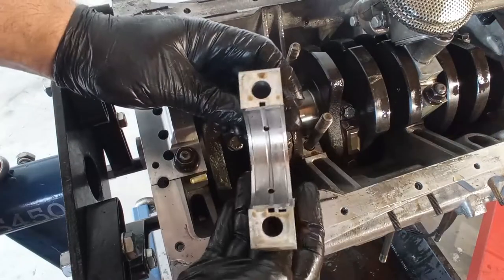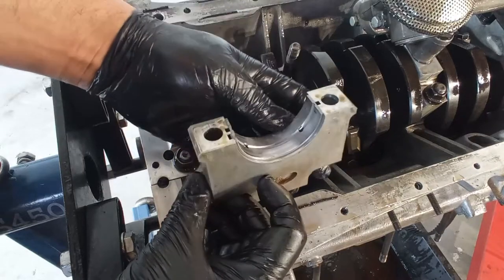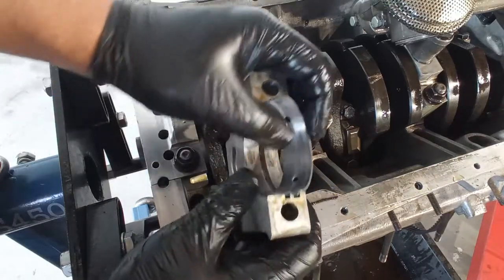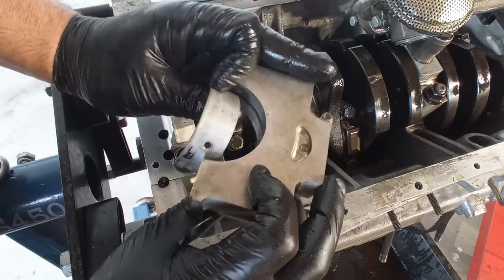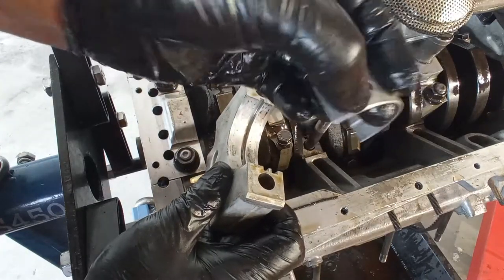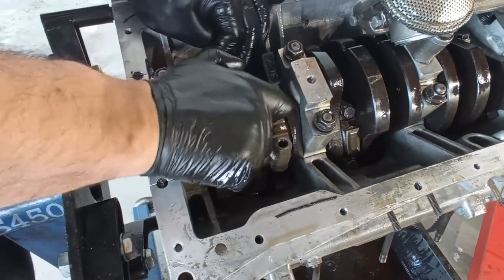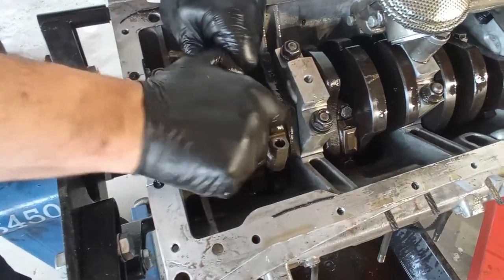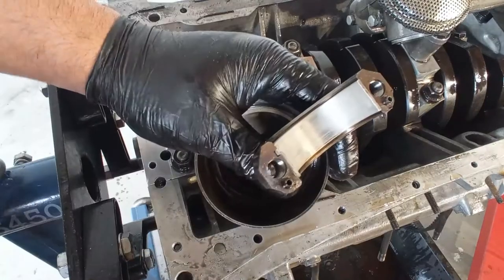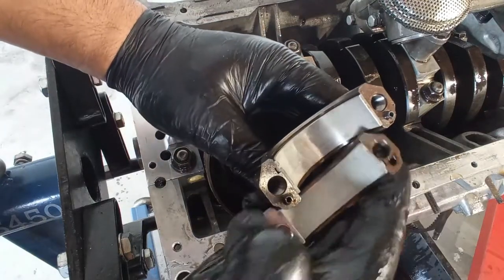On the support bearing, I have a few marks. On the new engine with 0 kilometers or miles, this is not good. Okay, I believe it's not very good. Checking out other stuff, I notice it is a standard measurement of bearing, half bearing. So let's take out the bearings for the con rods to see if I can find anything strange. And at first glance, wow, new, awesome. But no, the other half is already a bit scuffed up. And I think I know why.